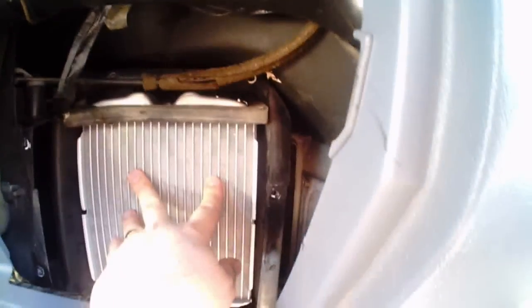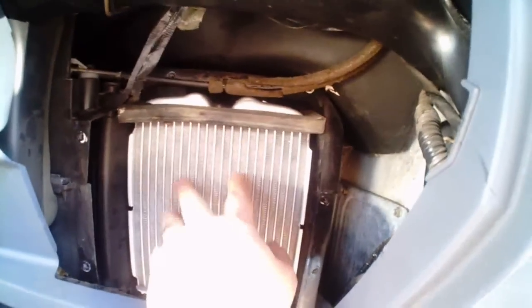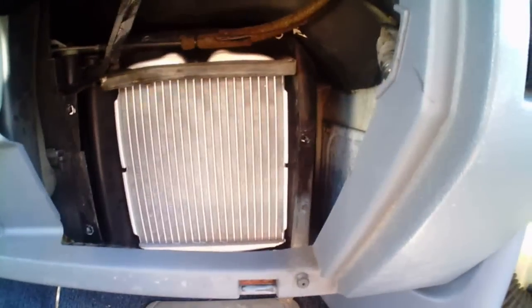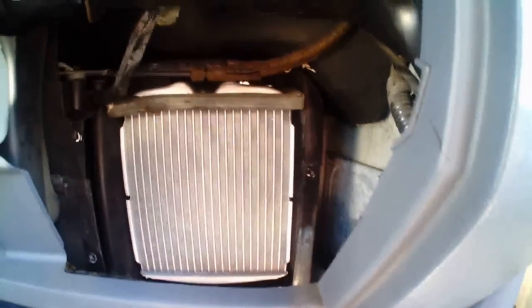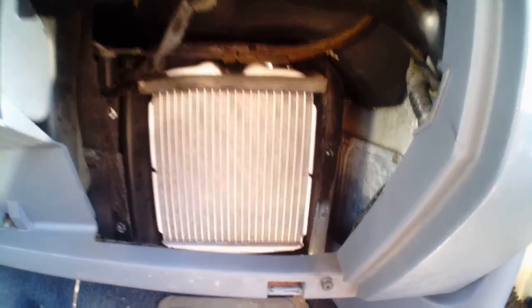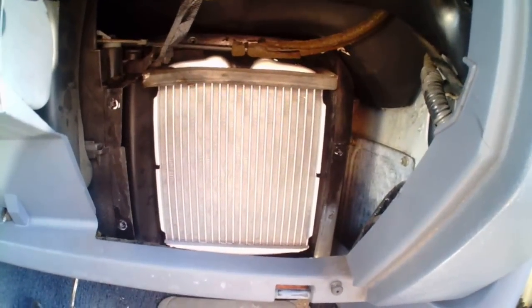I went ahead and re-added the foam rubber off the top. I have a feeling that will keep a good seal, because it'll also pressure it up here and keep it in place. I don't think I'm going to need any more of the foam rubber. Not a big deal for me. Maybe somebody else wants to add a lot more, but I'm not too particular. This is kind of an old truck. So now I'm going to bolt it all back together, put the cover back on, and then I'll get the coolant back in the radiator, and I will get this thing tested.